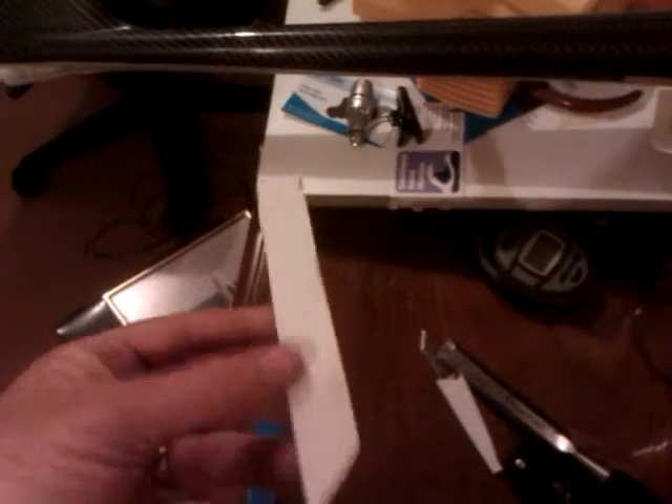This is just me hand-laying a piece up on a sheet of glass. It's fiberglass as well with polyester resin, pretty much the same as the original component, but I'm probably down to about 1.2 or 1.5 times as much resin as fiber, so it should be a lot more resilient. Like I say, there's no trick to it — this is just to give you a demonstration of why your car broke.